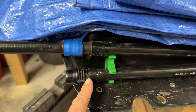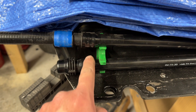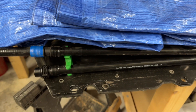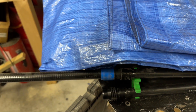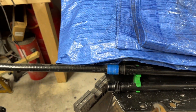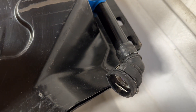With these coolant lines on the battery pack — this one I shortened, heated up and pressed back over. It's not just relying on the barbs, there's a ring in there. I'll probably put a band clamp over as well. There are two that needed that. Luckily this one ends with that fitting and that one has got to go off up to the penthouse in a new location, so I'll just get some flexible hose to go off that one. The other one on the front I managed to push on fairly well. If they don't work I'll just replace them with some aluminium tube going all the way back, swage those and then just have some short lengths of rubber or silicone hose onto these fittings.